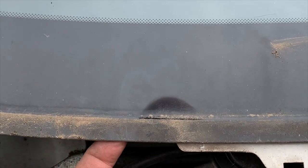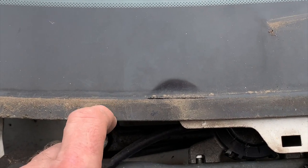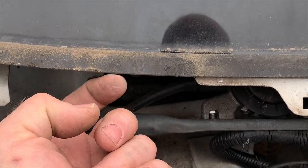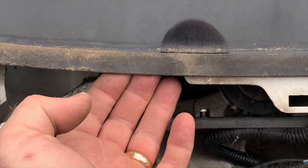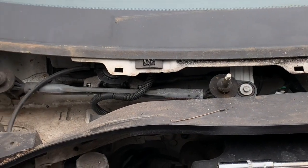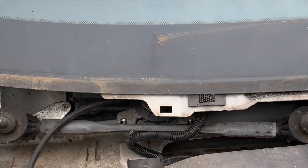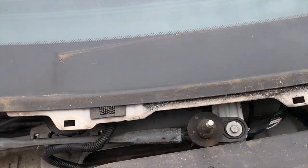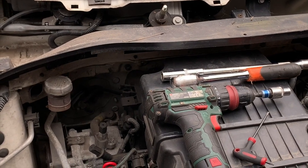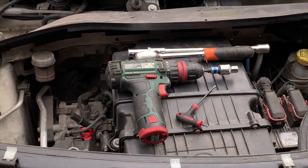If you get the clips just under the glass it won't go down properly, so what you'll be tempted to do is bash it. Being at the edge of the glass, you're likely to cause a fracture you won't even see, and a week or two weeks down the line you'll start seeing a crack going up your windscreen. The metal is about five or six mil back from the bottom of the glass - about halfway between the edge of the glass and where that dirty bit ends. I had a brand new windscreen fitted, put this back on, and a week later saw the cracks. It's an expensive mistake.